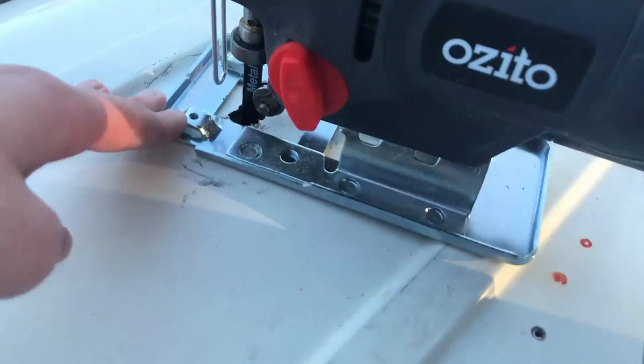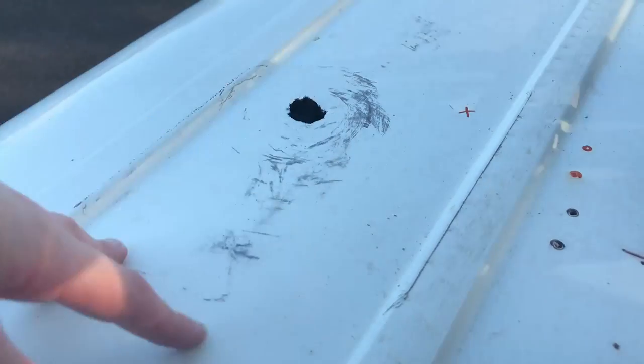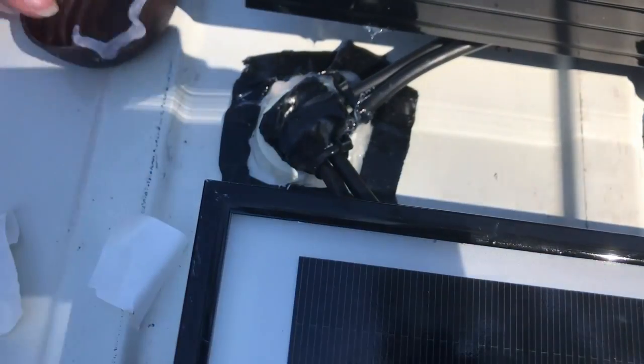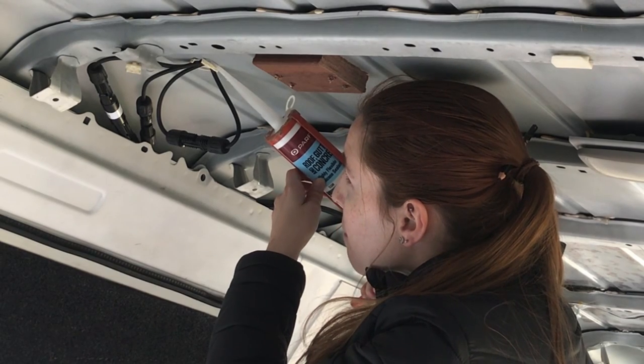I ran a bit of silicone around the edge of the brackets and around the top of the screws. As for the cabling, I wanted to have as much of this inside the van as possible, so I drilled a hole large enough that the connectors could fit through and put the cabling down through this hole. I decided to keep things really basic by having the hole right next to the solar panels, and I used a plastic lid which I cut a smaller opening in — only big enough for the cable itself — then stuck that down and sealed it all with silicone, and I haven't had any leaks.